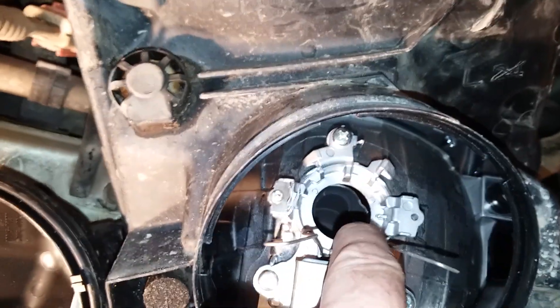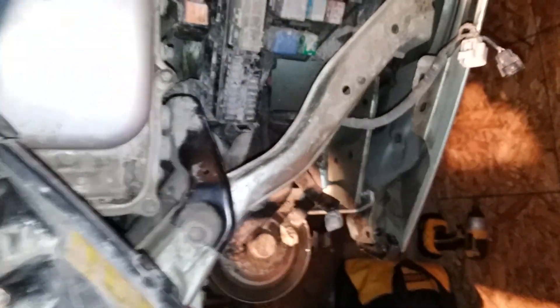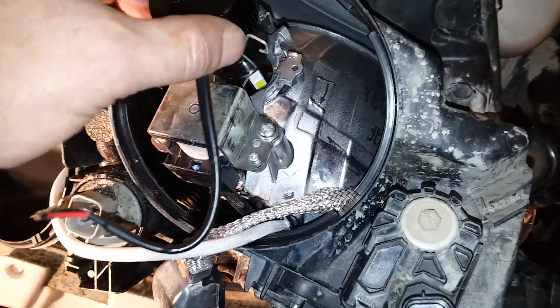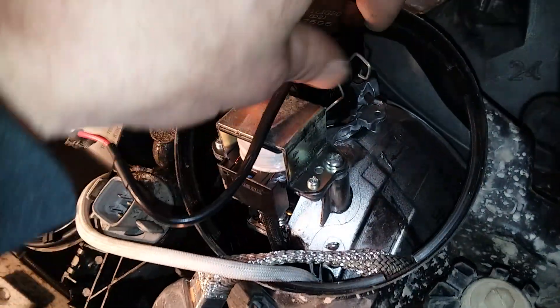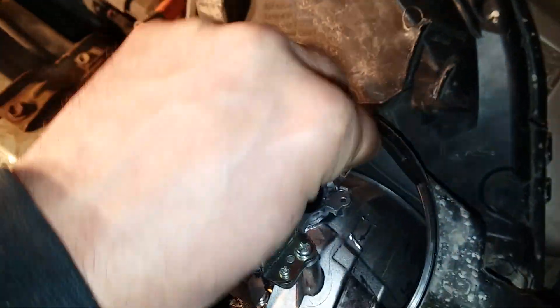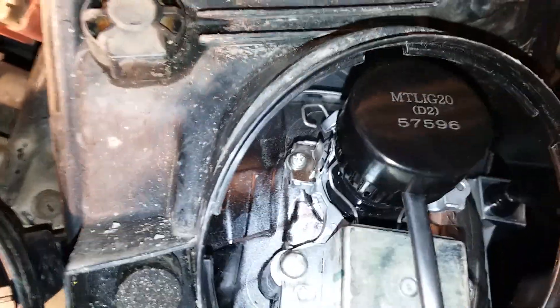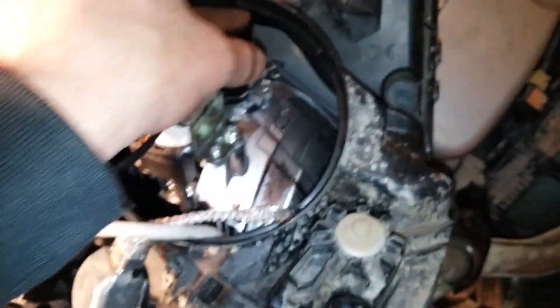The area you're trying to fit in is up here and then this little slot down there. Get this spring pushed down over there, then put the light in. You kind of have to squeeze over the top of that — squeeze that little clip out and over. It went a lot easier with two hands on it. Get down in there — there we go. Then you just fasten the clips around the side. You kind of have to do it in one motion: put this in and squeeze that thing out and around the area on the back.